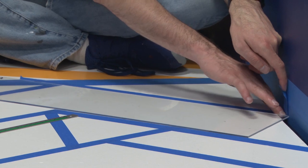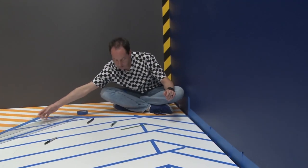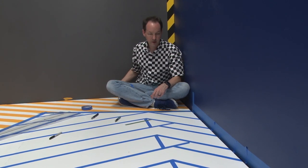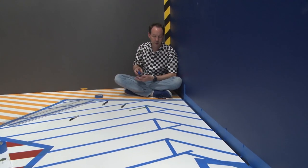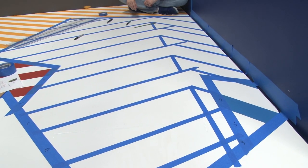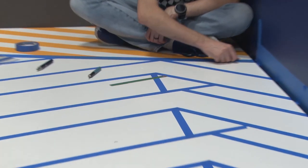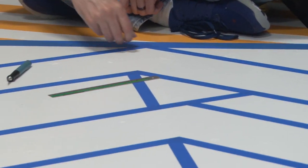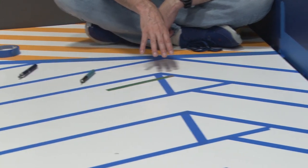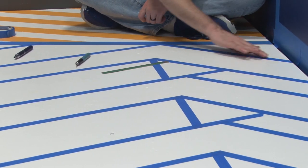Okay, and that is our last piece down. So now we have our shape worked out. We have a couple pieces to trim way back in stripe one. And as we work our way there, we got to set all these edges. And this is just thumbnail work. So you go along and you check everything. Make sure you're good all over because you're going to be putting paint down in the stripes. So these edges have to be perfect, especially all the way up to the ends.